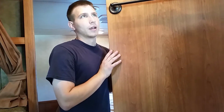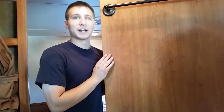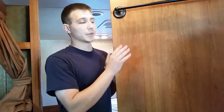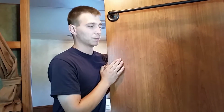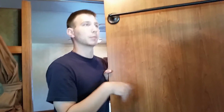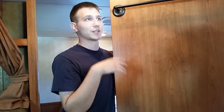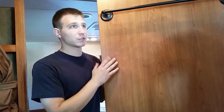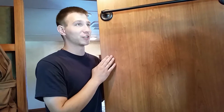So why would there be toilet paper in the gray tank? You never know. Kids or anything like that. But normally there wouldn't be. It's just going to be strictly in the black tank. Normally why a gray tank misreads is too much soap. It bubbles up, dries on the sensor. Is there a certain soap that you should use then? There's not a special soap, because it all makes bubbles and it all dries up eventually.